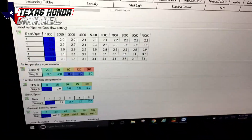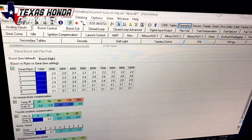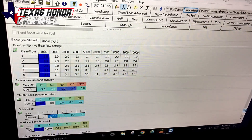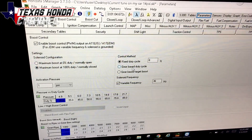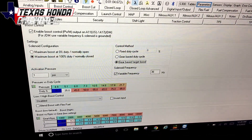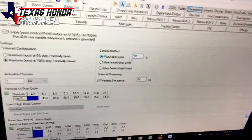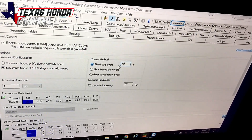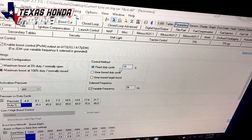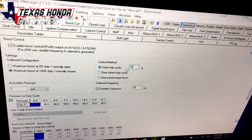He's testing it in here. You can see it says 'quick spool' — that's going to be cool whenever we get to that; this thing doesn't spool very fast with this big turbo. He's got it at 10 percent duty cycle, so he wants me to go get on it, data log the session, see where I sit, and then up it in 5 to 10 percent increments at a time until I get where I need to be. He said sometimes 15 to 20 percent could only result in one to two PSI, so it just depends how this solenoid setup and my setup is liking it. We're going to go out and do some pulls.